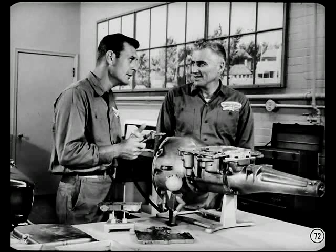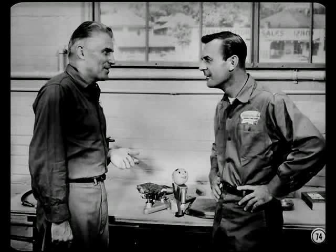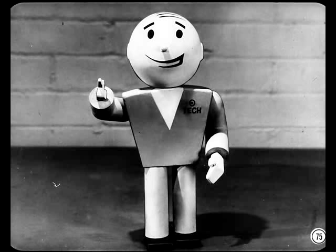The air pressure test won't tell me anything more than I've already learned from the hydraulic pressure tests. Where I do use air pressure tests is after I've overhauled a transmission — it's the best way to test the seals and make sure all pistons and servos are working right. Whenever you smell that strong burned odor, you can bet on a clutch or band failure, and some valves and passages are probably clogged with friction material too. Be sure to clean and flush the entire transmission, including the torque converter, oil cooler, and cooler lines, and replace the filter. Remember, bands and clutches don't fail without reason — find and correct the cause of failure. Careful inspection of all the parts is your best insurance against comebacks on a major transmission repair job.